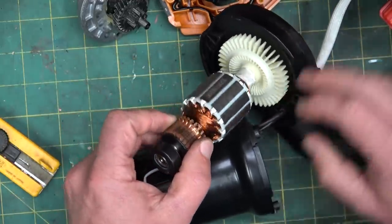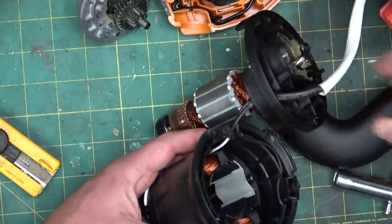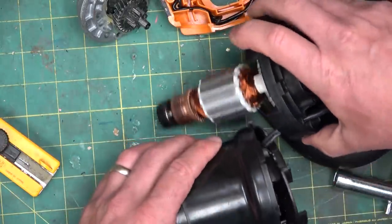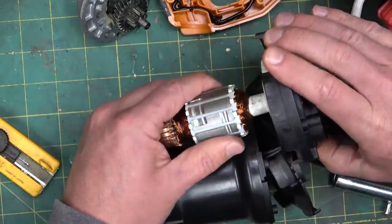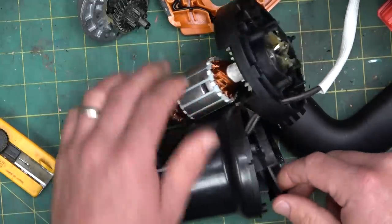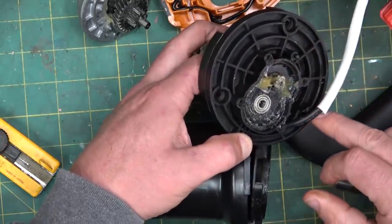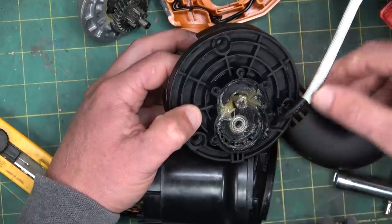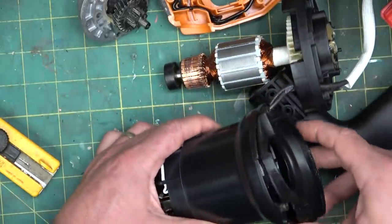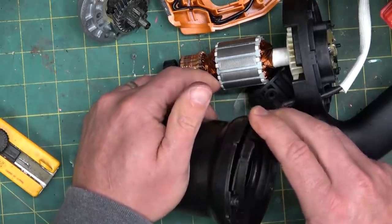And you see this is a bi-directional motor because the fan blades are straight. It's a little centrifugal fan in this ducting in order to cool it. Now you see the difference again. Fairly nasty looking front molding piece here, and not a bad looking molding piece here. I don't know why you'd have PA66 in the front and PP in the rear, but that's what they've decided to do according to their own markings.